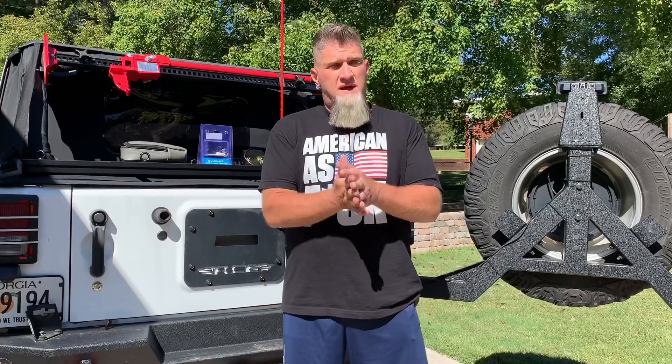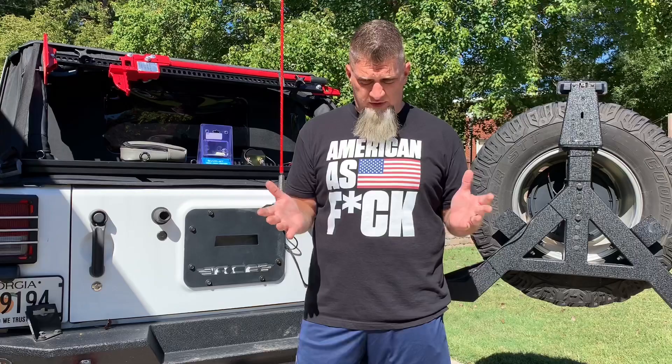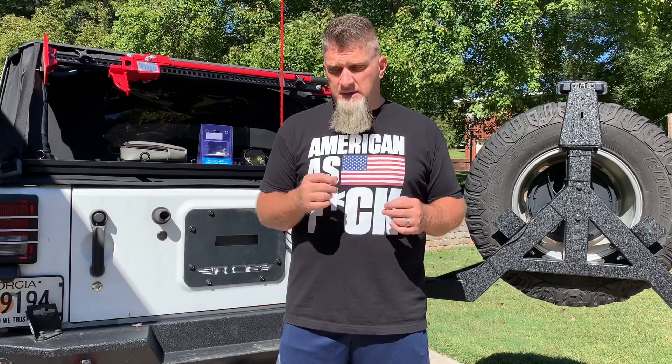That's the video. A couple of tips: when tuning the tip of the antenna you can go pretty drastic — one or two turns just to see how it reacts on the meter, which helps through the learning process. But ideally you want to do small adjustments because it affects both your high and low channels. You want to get your high and low channel SWR readings as close to each other as possible — eighth to quarter-inch turns on the tuning tip is perfectly fine. Baby steps to get it dialed in.